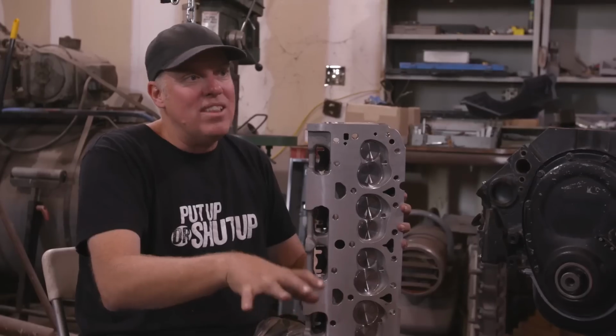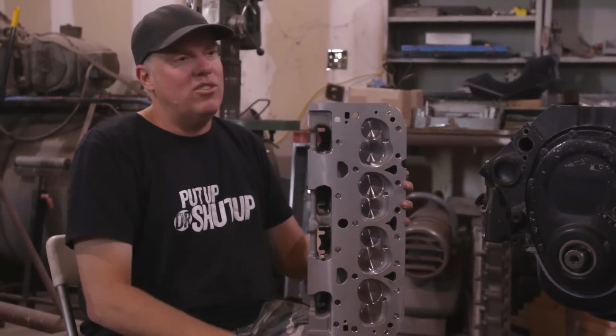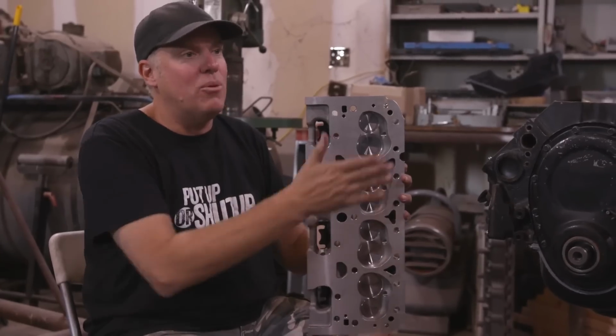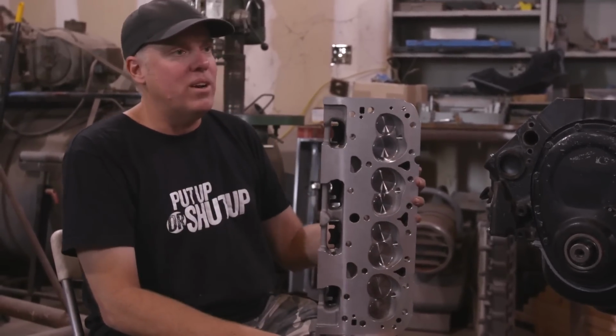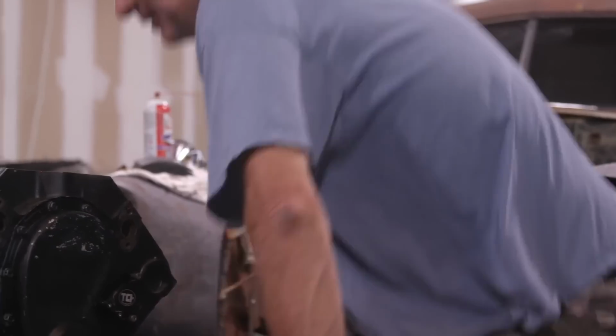And then, if I take that... There's a 406, more? Yeah. Then, if I take that second engine, that 406, and want to not run the blower on it, I can go get some 64cc heads, and that short block will then give me 10 3/4 to 1. So see, I've got this scienced out deep into the future. Okay, I buy it. Let's put them on. Install it. There.